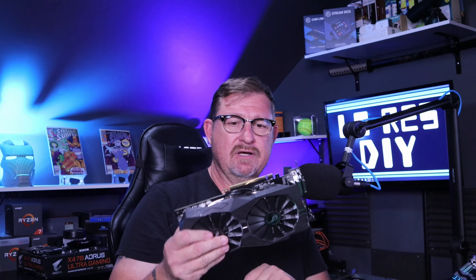What are you going to need to do this? Obviously the first thing you're going to need is a graphics card. If your Proxmox machine is made up of an old desktop, or if you're lucky and have something like an R710 or even R210s, you can get 16x PCI slots — which most graphics cards use — and plug it in.